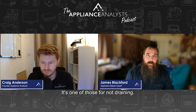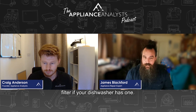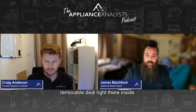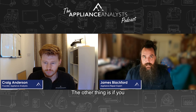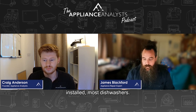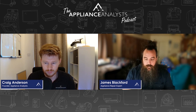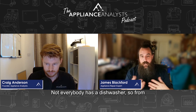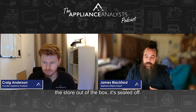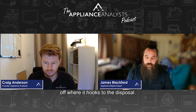For not draining, sometimes it's something very simple. So you want to check your filter if your dishwasher has one. A lot of times it's just a removable deal right there inside. The other thing is if you recently had a garbage disposal installed, most dishwashers, the drain line's hooked to the garbage disposal. On a new garbage disposal, where that drain line hooks to, not everybody has a dishwasher, so from the store out of the box it's sealed off, and so you want to take your drain line off where it hooks to the disposal.